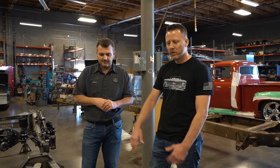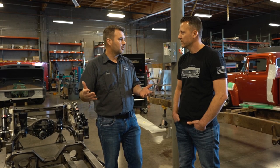Originally the idea was to take our C10 platform and just transfer it over to the Ford trucks. Unfortunately, with the Coyote motors being so much wider, we had to do a whole different revision on the front end — making a wider front cross member and wider frame rails to allow that Coyote motor to fit nicely inside the frame. So what you're not getting is just a revamped Chevy C10 product in a Ford; it's actually been completely designed from the ground up to work with the Ford pickup truck.